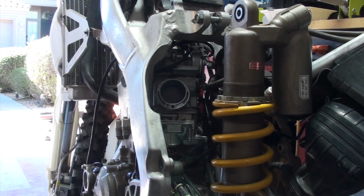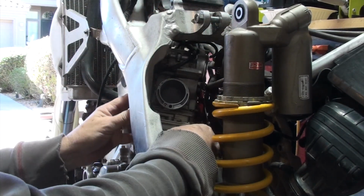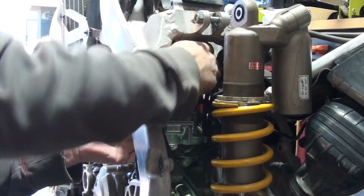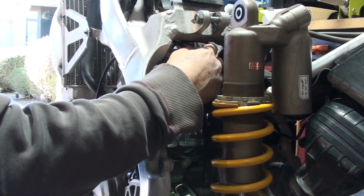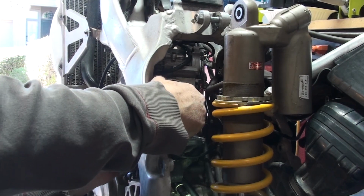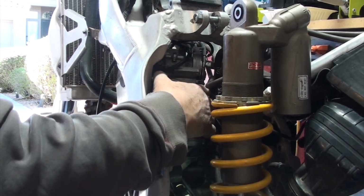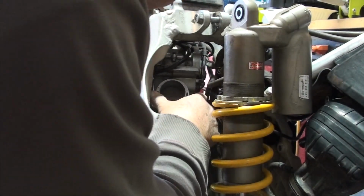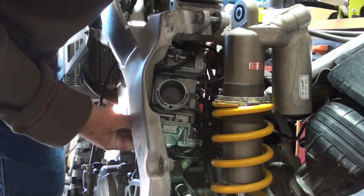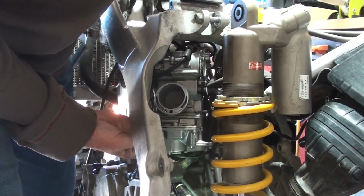So I totally feel like I'm forgetting something, but here's the carb that I want to take out, right out of this area. And I can move the carb freely where it's connected to the boot, but struggling a little bit to get it detached appropriately. Now there is another band. I'm wondering if I can take off. Here we go. That seems to work, spinning and pulling and just working it to get it off. Everything is disconnected. And there we go. Popped it off.